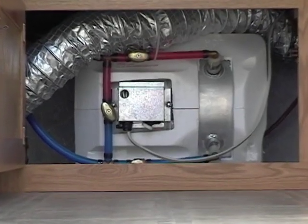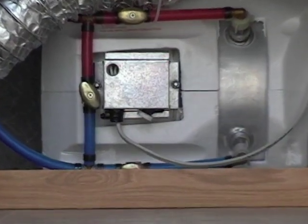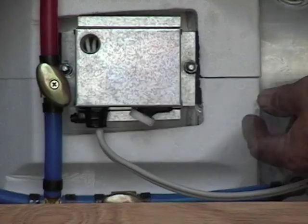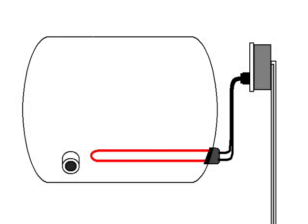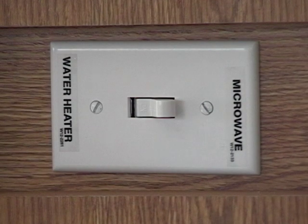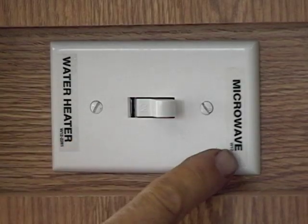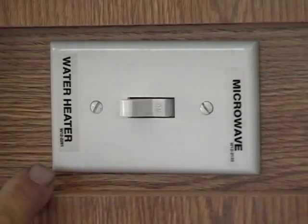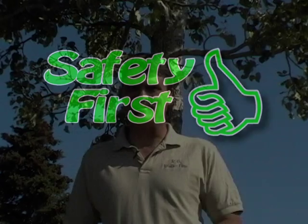If your water heater is equipped with an optional electric heater, you can save on propane and they're a lot quieter. Of course, you have to be plugged into power for them to work, and they can use as much as 13 amps to run, so you can't use them everywhere. These have a separate element and thermostat, and you can increase the temperature on these ones too. Some RVs have a switch inside the coach to turn them on and off — they look like a regular light switch and are usually marked 'water heater.' They all have a small switch on the water heater itself. If you have both switches, both have to be on for the electric water heater to work.